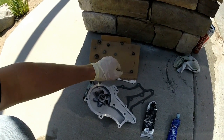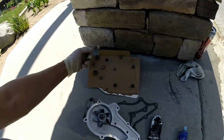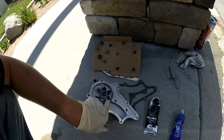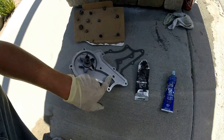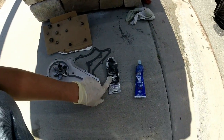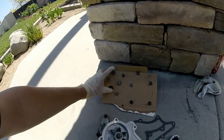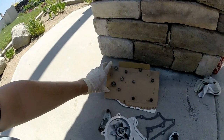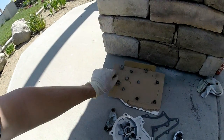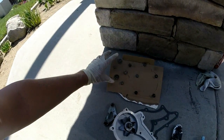One will have the blue RTV and then this one right here goes straight through and it'll have the black RTV because that's going straight through the water pump — it's not screwing in right there, so that needs to have an oil seal. Obviously the last two bolts will go in. I'll hand-tighten those two, then tighten those ones down, then get to these two.